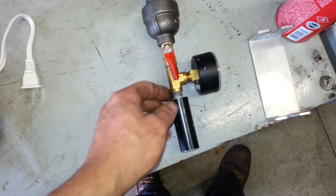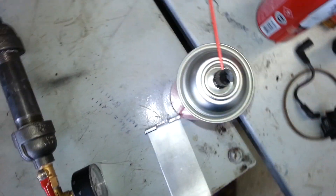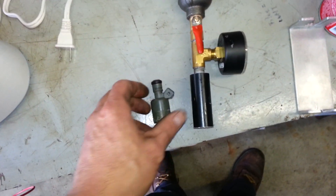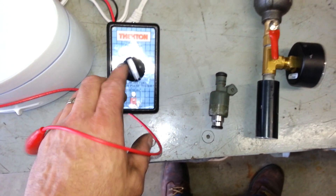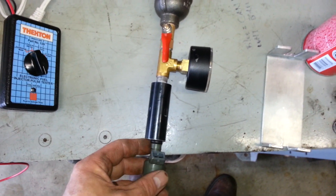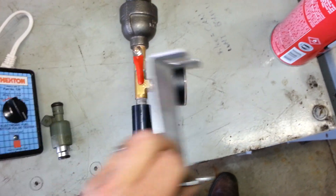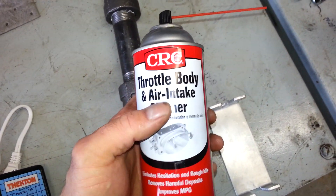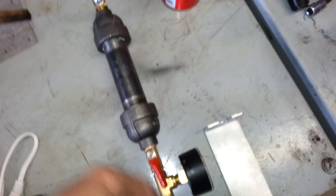I put a pressure gauge on there. I didn't make this piece on the lathe — I think that was a 9/16 hole for the injector. You can cycle these with double A's, but I already have a tool for that — the Stexton — where you're able to dial in the time interval or set it to continuous. With the injector slid in there and a simple piece of aluminum bent up to trap it, it works well. I've been using the throttle body and intake cleaner — fill it up to the port, pressurize it to about 35-36 PSI, and then cycle it.